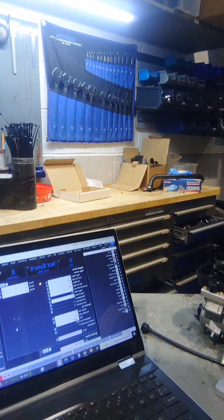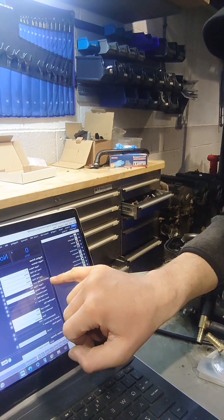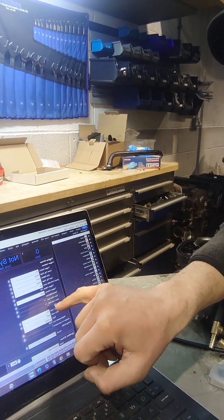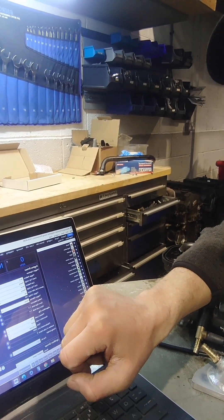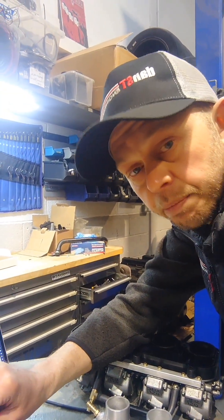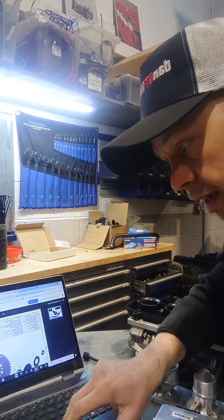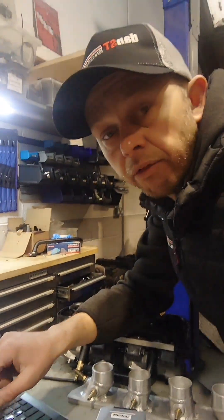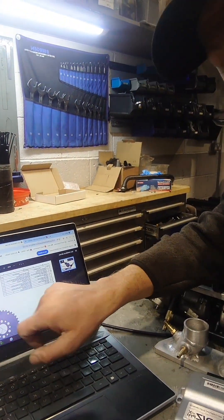This makes sure your belt is still running in the correct position. Over at the laptop, we've got the base map loaded for this car. The important value is 102 — that's the trigger offset in the start menu under engine driver. That 102 degree offset means the sensor sees the gap or missing tooth 102 degrees before the engine reaches top dead centre. There's also a useful drawing available on our website — off any of the 924 listings under the attachments tab — which shows you the assembly and gives you that 102 degree offset.